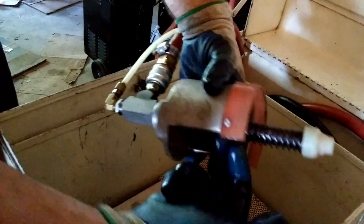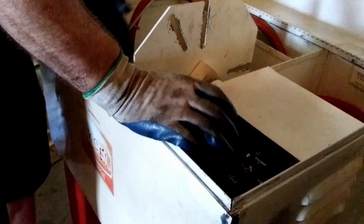Tighten down the wing nut, then you're ready to come over to the controls. Your torque converter will be in there with all attachments attached. You have your timer, but first you want to select either pump or cycle. When you put it on pump, the fluid comes from inside the machine, through the pump, through this hose, goes through the attachment into the torque converter, then spills out and drops back down into the machine. Keep the lid closed for operation. If you want it to cycle for a much better cleaning of the torque converter, you first need to look down here — there is an attachment to connect an air hose from your air compressor to supply air to the machine.